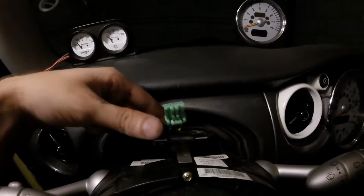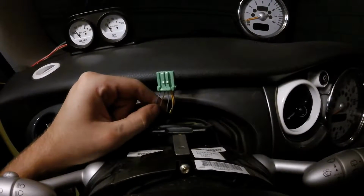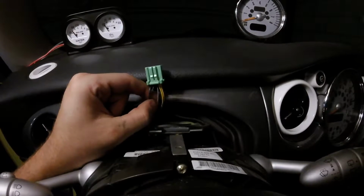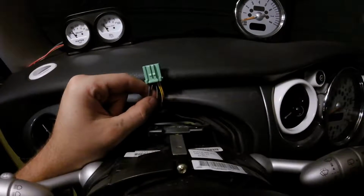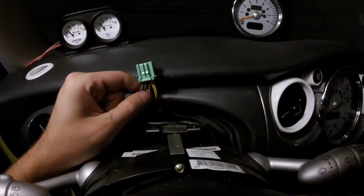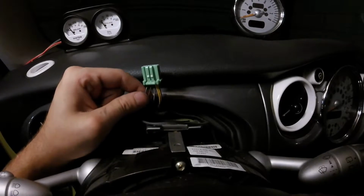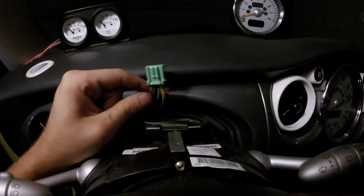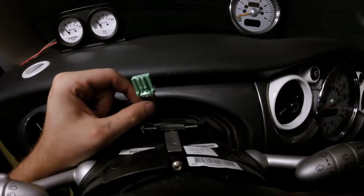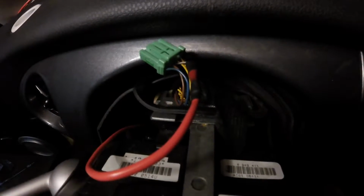In this case, I've gotten in here a couple times and tried to mock it up with the soldering iron and everything, and I just won't be able to film it the way I want to and get soldering in here at the same time. So we're going to go back and we're going to use another butt connector. We're going to make sure we've got a nice solid connection before we consider this done, because we definitely don't want this kind of thing shorting out, because this will also control the backlight on the tachometer, and we don't want that going out.